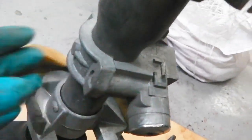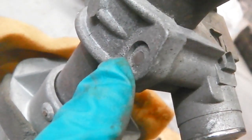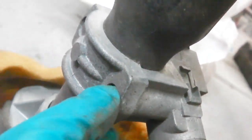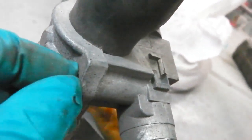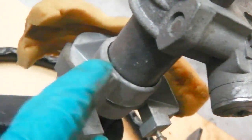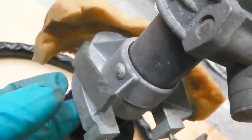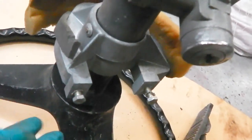Then there's some one-way bolts, what they call snap bolts, on the steering column bracket. We have to chisel those round to undo them because they would normally have had a little head on them. You tighten up and then the torque snaps the head off, so you can't steal the car by just going under the cowl and unwinding the bolts, taking the steering lock off. It's a theft device. Then you've got some rivets there which hold the stalk mounting screw plate bracket on.